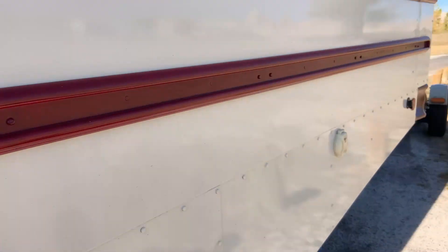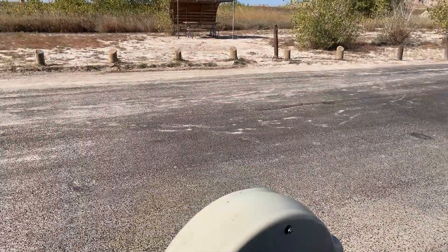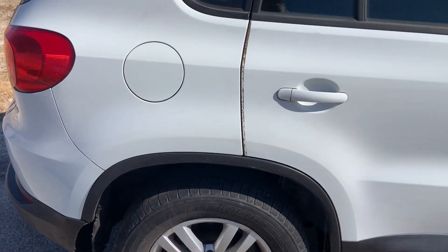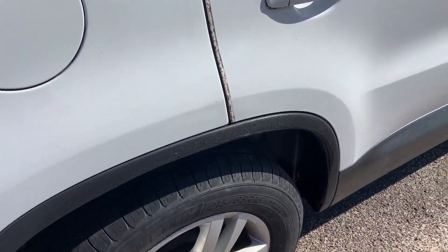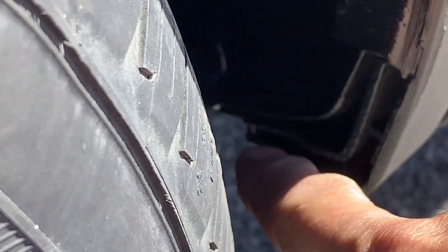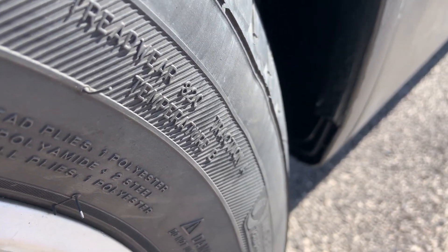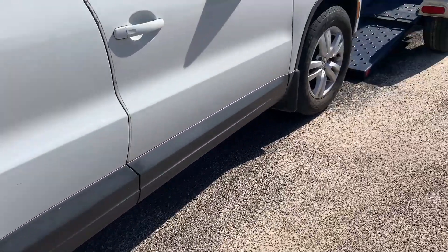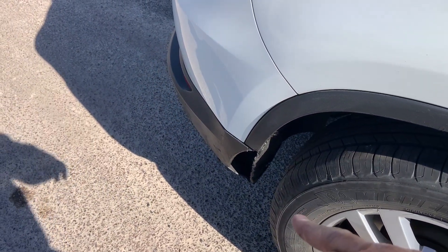When we had the fiasco with the exploding tire on the Volkswagen Tiguan - I should show you the recovery on that. I just got done with a little minor touch-up. All the black stuff that was around here was melted rubber crud that came off easily with gasoline. There was a spot where the metal was exposed from the tire hitting it, the fender liner is missing, and the paint got abraded. I went and bought some Flex Seal, which is a fabulous undercoat - very strong stuff, better than Rust-Oleum undercoating. This plastic piece of trim needs to be replaced, along with the back bumper, mud flap, and fender liner.